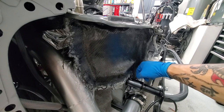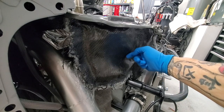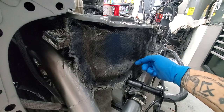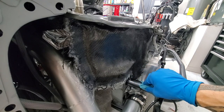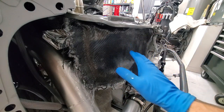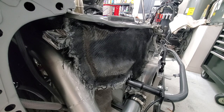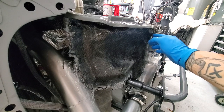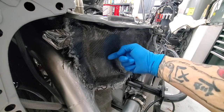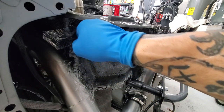It's too small and too complex to use a fin roller — that's the metal roller guys. We're not really trying to get the air out because we've already done that on the table — there's no air in this at all. That's why we laid it up on the table first. If we had to do one piece of carbon, then the 1708, then another piece of carbon all inside the car, it would be a lot of extra work. The carbon bends and moves way easier than the 1708 fiberglass, however doing it this way makes it just that much stronger. We're going to let this cure and after it dries we'll pop it off.